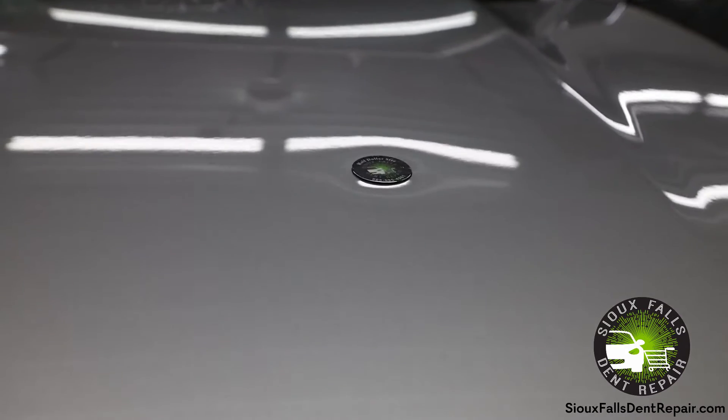To start the repair, we go ahead and lift the hood open. That allows us to access the hood insulator pad. From there we remove six different under-hood clips that hold the insulator pad to the bottom of the hood, which allows the insulator pad to be removed safely.